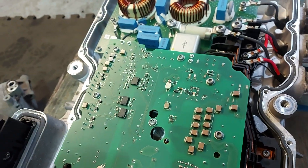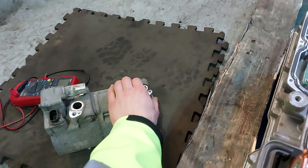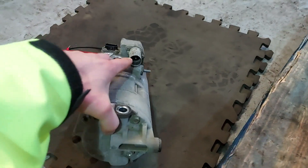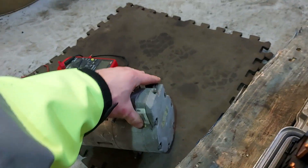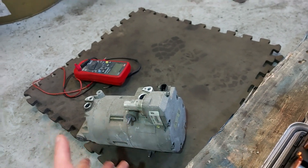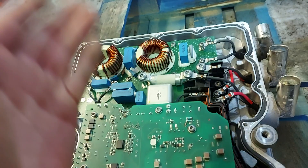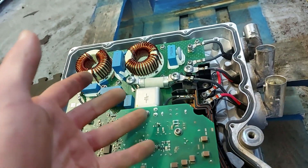The thing that's really puzzling me is that there's just no short circuit anywhere that I can find. Hunter can't find one either, so I've measured in here — no short circuit at all. So my theory is that the windings are shorted, and when the inverter inside turns on it's just trying to put power into those shorted windings, and that's what's blowing the fuse. Remember it was the PTC heater, it was the heating that failed last. So that suggests to me that there might be a short inside the PTC heater somewhere.